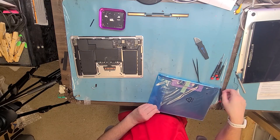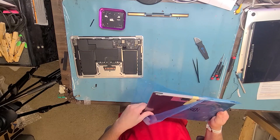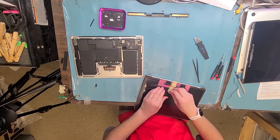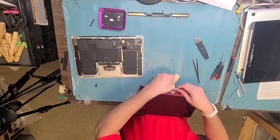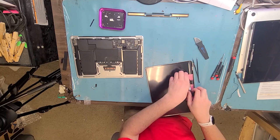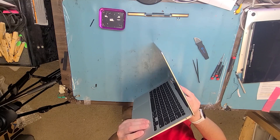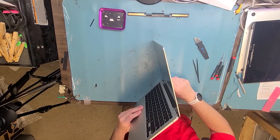Here is the new screen. You want to tilt it back up here, slide the hinge together, and make sure you pull out the LCD board — don't close it on the board. It's clipped in a little bit. Grab that T8 screwdriver and put the screws just in the middle — you don't have to tighten them all the way.